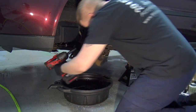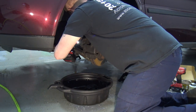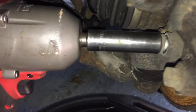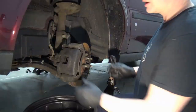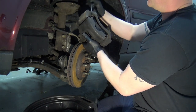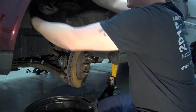Take those 15-millimeter bolts off in the back. Here's a close-up of those caliper bracket bolts — you can see where they're attached and where the impact goes in. Those are the ones bolted to the knuckle; the ones on the caliper itself stay in for this repair. Take the whole assembly off and use a hook to hang it onto the strut spring and get it out of the way. I'll link to all the parts and tools I'm using down below.